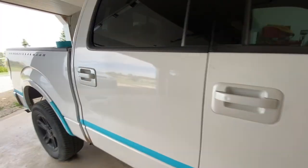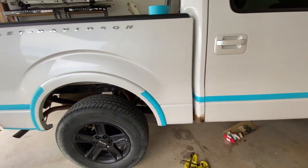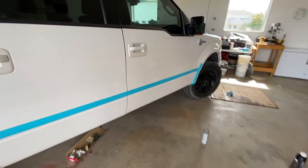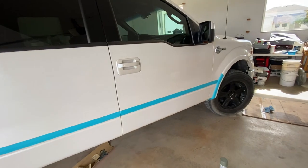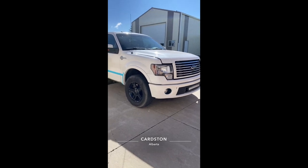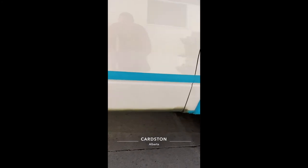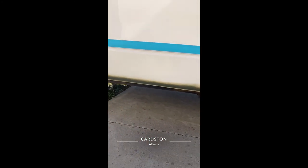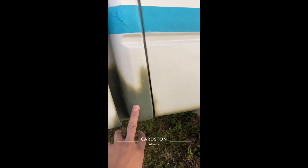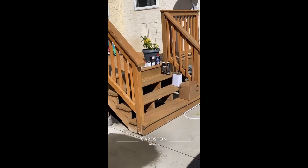There are some little areas I'm going to be touching up with primer, and then we're ready for the bed liner. The truck is outside — I'm getting the sun to warm up the metal a bit so the paint flows on nice. Primer was really easy to put on; I used 400 grit to sand it down. That cab corner I used fiberglass Bondo and it's literally solid as a rock. It's all prepped and I'm just warming up the paint outside.